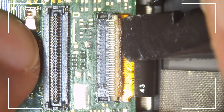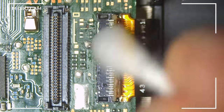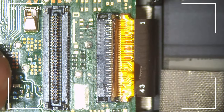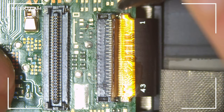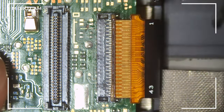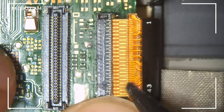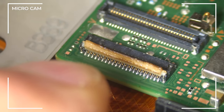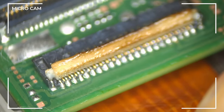I'm trying to open the connector with the flat end of a spudger — it feels like it could break at any moment. I'm using a cotton swab soaked in IPA (isopropyl alcohol) to loosen some of the hardened flux for easier opening. The connector is unlocked and we can now safely remove the ribbon cable with the pointy part of the spudger. Fortunately the cable itself looks good, which doesn't necessarily mean the OLED panel is working, but still good news. I don't think keeping this connector will be a viable solution for fixing the console.